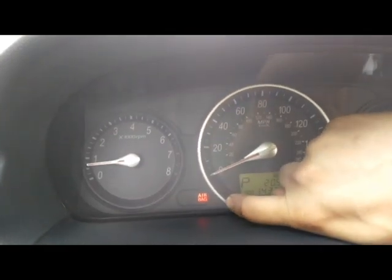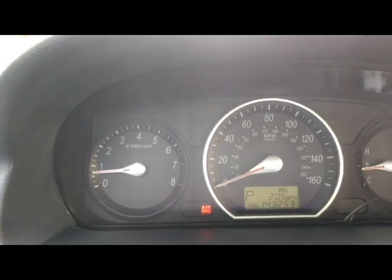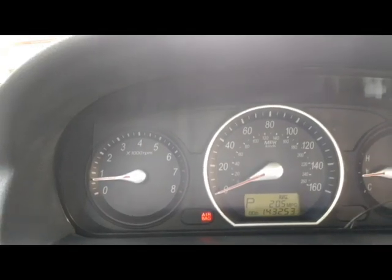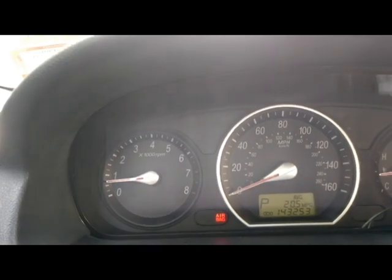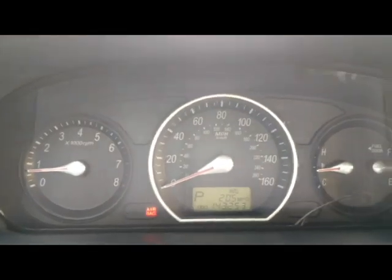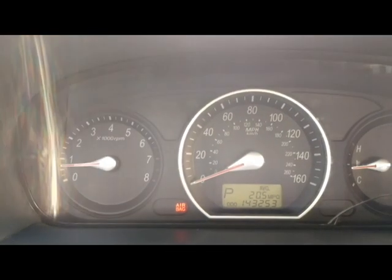Well, I know what's going on with this car because I already hooked in a diagnostic tool to the car, and I pulled the codes from the airbag module. I hooked in a Snap-on Solus, and I know what's going on with this car. But not everyone has a $1,000 scan tool like that. I have access to it. It's not mine. I have access to it because I work in a mechanic shop, and I have access to all these tools. And I pulled the code, and it's for the occupancy sensor, the passenger occupancy sensor, OCS.